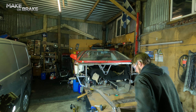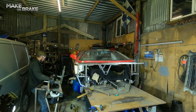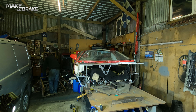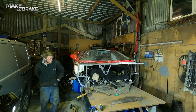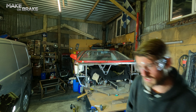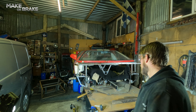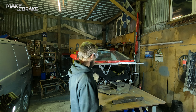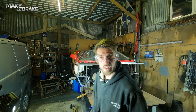It's not as heavy as it looks, I'm just trying to be careful. I'm very quickly running out of space. So, front end is removed — time to try and hang the front clam on, get it in position where it needs to be, get the bodywork looking roughly right, and then I can measure the centre of my front wheel arches and remark our table as to where the centre of our front wheel should be.